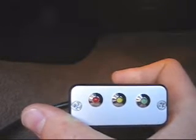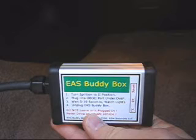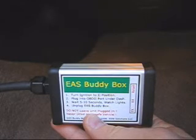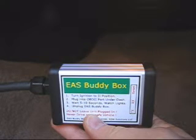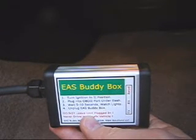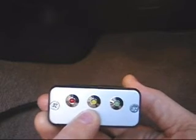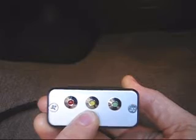There's actually a fair amount of information you can glean from these LEDs when troubleshooting a connection that won't establish. There have been a couple of instances where users have run into problems where there were wiring issues, and the actual EAS computer was physically disconnected from the OBD2 port. Over the years, corrosion, physical vibration, and trauma to the vehicle had broken these wires. So if you see that pattern where the yellow LED is not responding, the first area to check is the physical connectivity between your OBD2 port and your EAS computer.